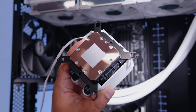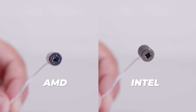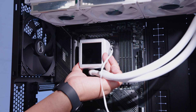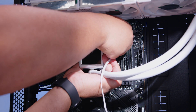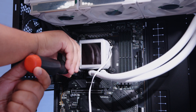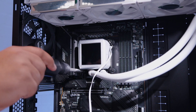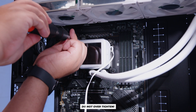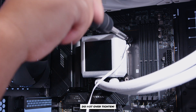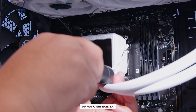Now is a good time to remove the plastic cover from the cold plate to expose the pre-installed thermal paste. The difference between the AMD and Intel bolts is that AMD bolts have four dots and Intel ones don't. Mounting is the same because the bracket on the cooler does not change. Lower the cooler onto the IHS, use the appropriate bolts, finger-tighten one, then fasten the one diagonally to hold it in place. Don't tighten all the way just yet — you'll need a little jiggling to align correctly. Once aligned, fasten into place but do not over-tighten.